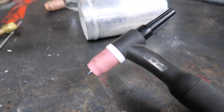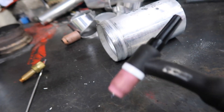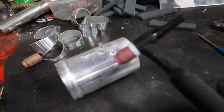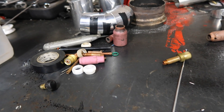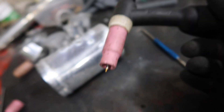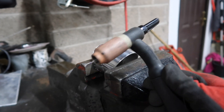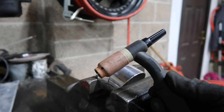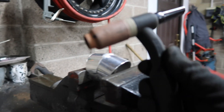First torch — the pyrex cup smashed into a million pieces. I just cannot get this thing right — too little gas, too much gas, too much AC balance one way or another. I'm going to go back and try one of the older styles with no gas lens. First time — it's laying an all right sort of bead. I'll try the gas lens again just for the craic. Yeah, this combination is working best for me: 1.6 mil tungsten, 2% lanthanated, on a gas lens — I think it's a size 10 cup. It's tacking nicely and hopefully we can lay some beads.